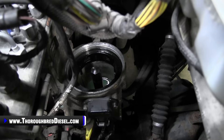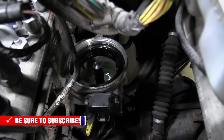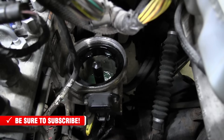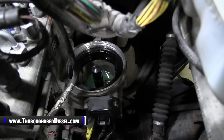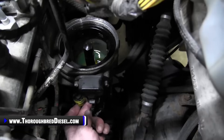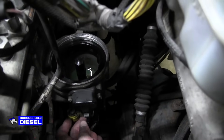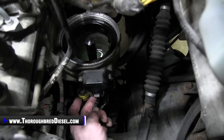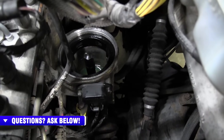Now what I'm going to do is check my fuel pump flow — I like to do this too. I just get in the truck, turn the key on for just a second, let the fuel pump run, and make sure I'm getting fuel flow out to the canister. Just do it for a second to make sure I've got fuel flow. That is unfiltered fuel, so what I'll do is open my drain canister back up for just a second and let the unfiltered fuel back out. This is probably a little bit of overkill, but you always want to make sure you're running filtered fuel through to your injectors. Open the drain one more time, send that fuel out, then close it off and put our filter back in.